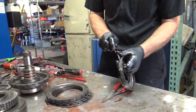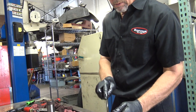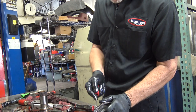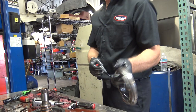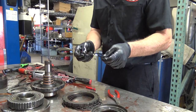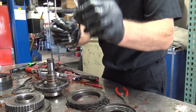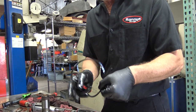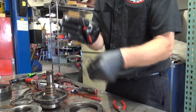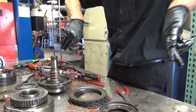If you ever use these tools, be very careful — they puncture skin. The cross-section on this seal is kind of like a straight section that's held into the groove, and then it has typically a 45-degree lip seal.